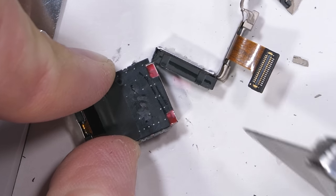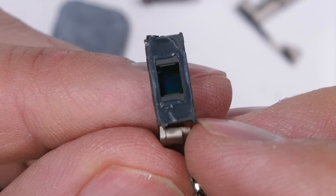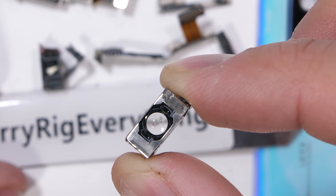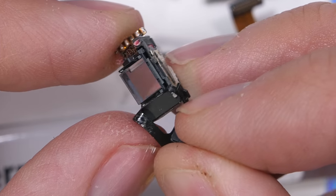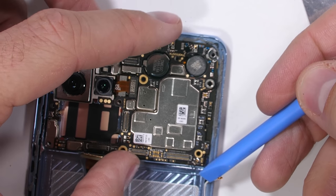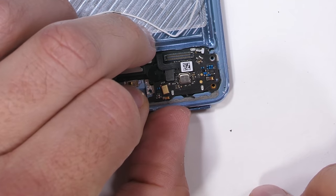After the final metal side has popped off, at the end of the camera unit is where the sensor itself resides — kind of like the camera body of a professional DSLR, since it captures all the image data and sends it to the phone. The rest of the block is the lens, or glass as photographers call it, which magnifies the object and brings it 5 times closer — the actual telephoto lens. The third segment is the angled mirror that allows the whole thing to lay flat inside the phone instead of sticking out 2 or 3 centimeters. This 5x zoom lens takes up maybe 30-40% of the lengthwise space inside the phone, so by laying even more camera hardware flat, we could see 10 or 15 times optical zoom in the future. Congrats to Huawei for pioneering this idea — people are going to go pretty nuts when Apple comes up with it in a few years.